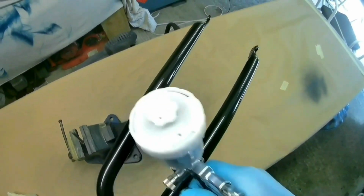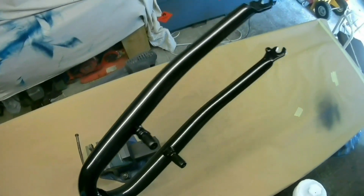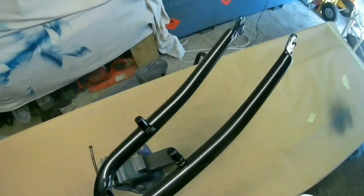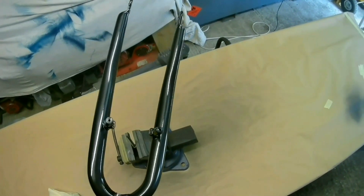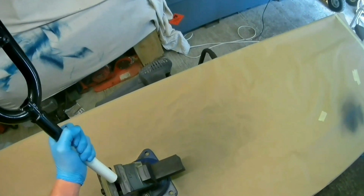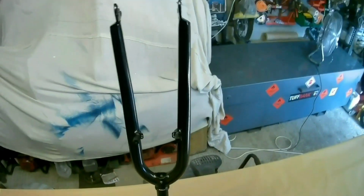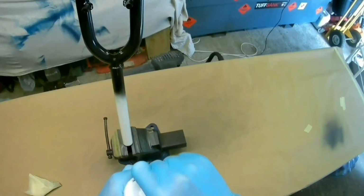So I find a smaller pot ideal for something like this, because the pot doesn't get in the way of anything, and a lot of the stuff I do is small. So I do use the 100 milliliter pot a reasonable amount. The 250 milliliter pot is a good pot. Having said that, the newer one has a better way of tightening at the top. It's like a copy of the LPH 80 cup, but it's taller, and it's not as good. So I prefer the original ANI R150 pot with the 250 milliliter pot, because it's a little bit wider, but it's not as high, and it just doesn't seem to get in the way for a lot of things I do.